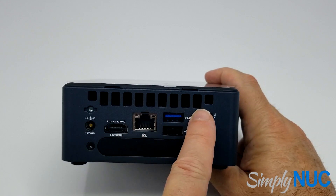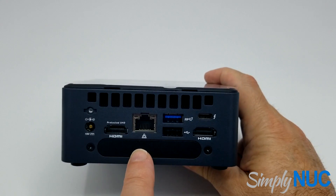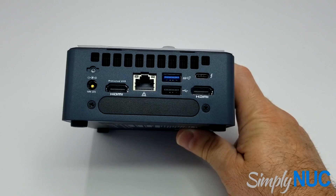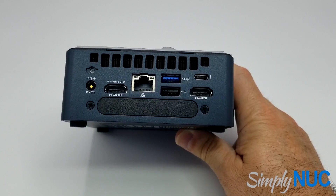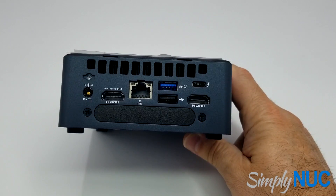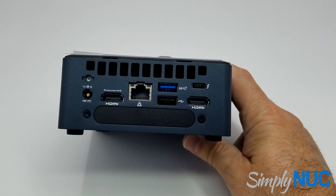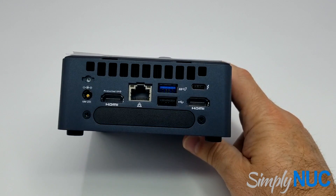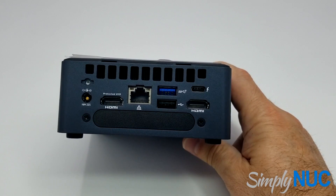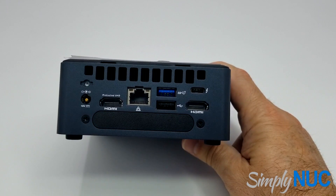The exhaust vents are a little bit larger, so we have much better cooling in this product. We have the optional IO accessory bay, and we're coming out with a couple of new accessories that will be covered separately. There are several different accessories that can go inside this product without requiring a lid. The DisplayPort is 1.4. There is an internal EDP connector for driving flat panels. You can get triple display now — either all three on the Type-C connector, or two through HDMI plus the others off the DisplayPort, or you can use the EDP, HDMI, and DisplayPort.